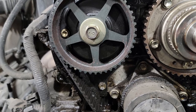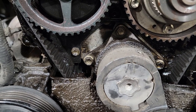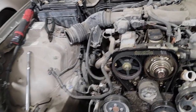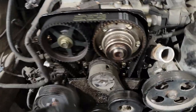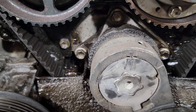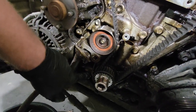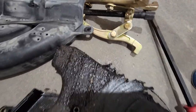Next thing you want to do — there are three 12 millimeter bolts: one there, one there, and one there. I 100% recommend using a magnet — make sure you have a magnet — because if you drop a bolt into the timing I do not advise trying to leave it there and hope for the best. I've always dropped one at least once. For the bottom cover, you'll have a bolt in the middle, a bolt right over here on the bottom of the water pump, a bolt at the very bottom, and then one right here that's kind of annoying to get to. The timing cover is held on pretty well regardless.